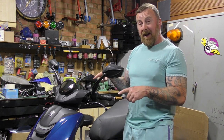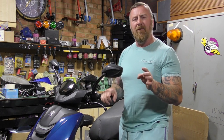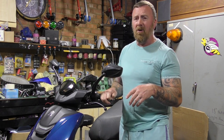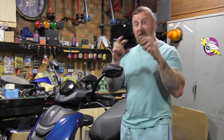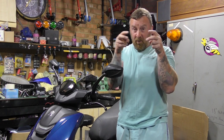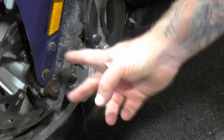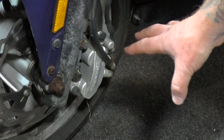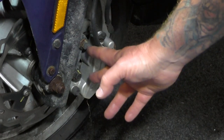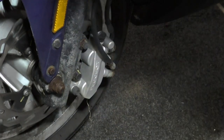I've now got to free up the front brake — it is binding. I've done a video on that before for the Aerox, where it jams up. So it's binding. This is a four-pot, okay — you've got four individual pots in this front brake. This is also a synchronized braking system, so you've got two there and two the other side. I've done this on a Speedfight 3 — we've just got to take the bolts out, get it off, lever it all back, clean it all up. Job done.